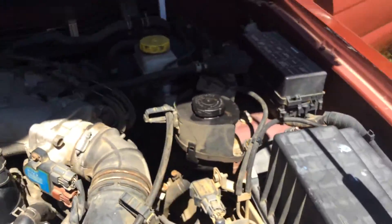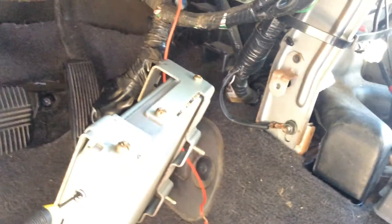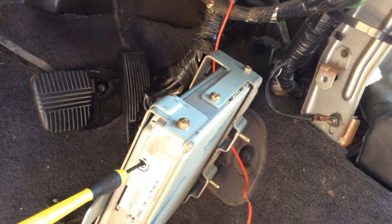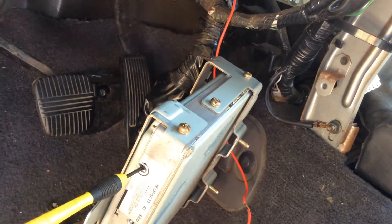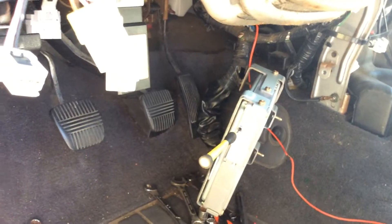I've even put in some extra ground connectors directly to the battery, and I'm thinking about bridging it directly to the battery terminal. There's also a ground by the driver's side kick panel, which on the ECM side inside the driving compartment is probably the ground more relevant to the computer itself. I always get a ground loop feedback in my stereo system that changes with engine speed — the higher the engine speed, the higher frequency the pitch on the radio, which indicates I've got a dirty ground in the vehicle overall.